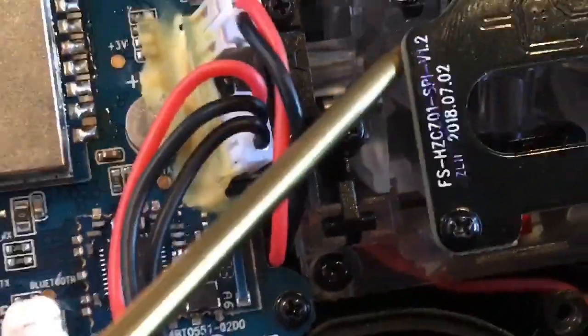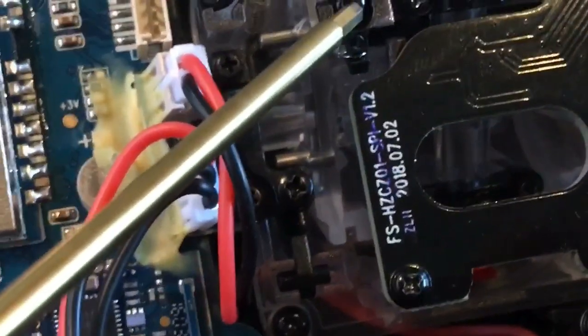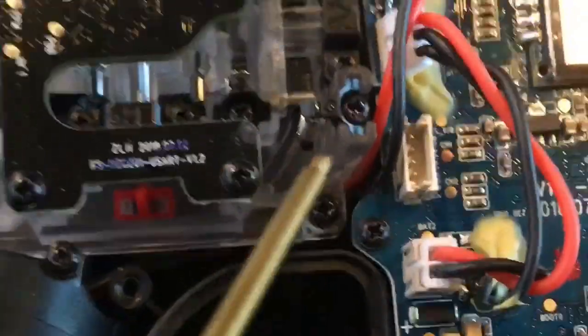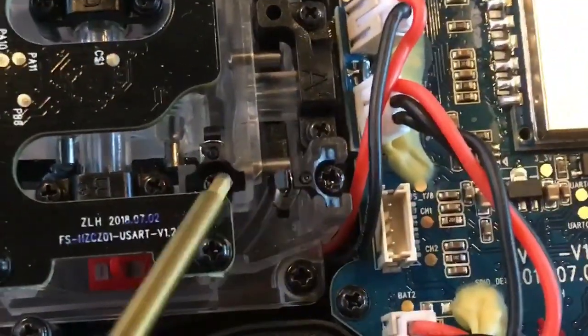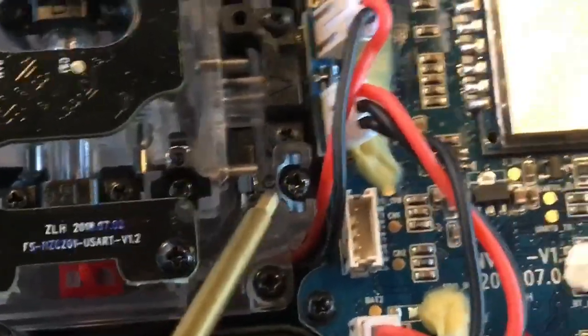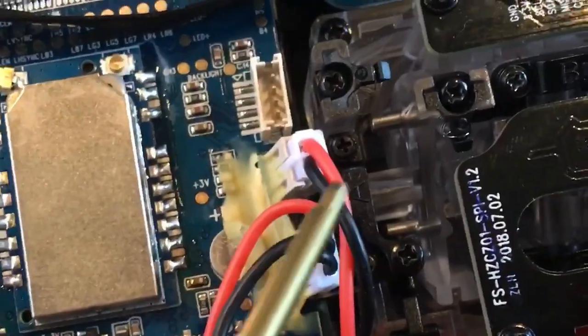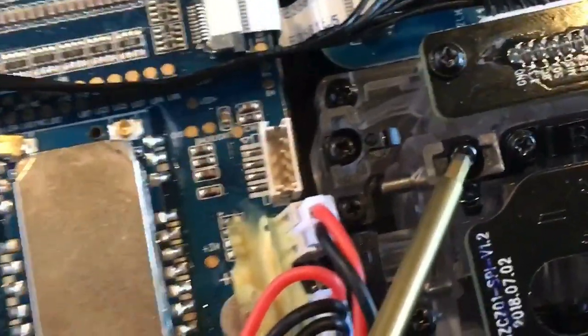I removed the other three, used heat, and bent the panel up out of the way, then put it back in. If you don't take the spring off it's pretty easy — just put a slightly longer screw in there and tighten it, and you can do that on all of your spring tension areas. There are two right here, one right here, and one right here — you can raise up these mounts with a longer screw. After my screw-up I just tightened that and left it backed off a little.